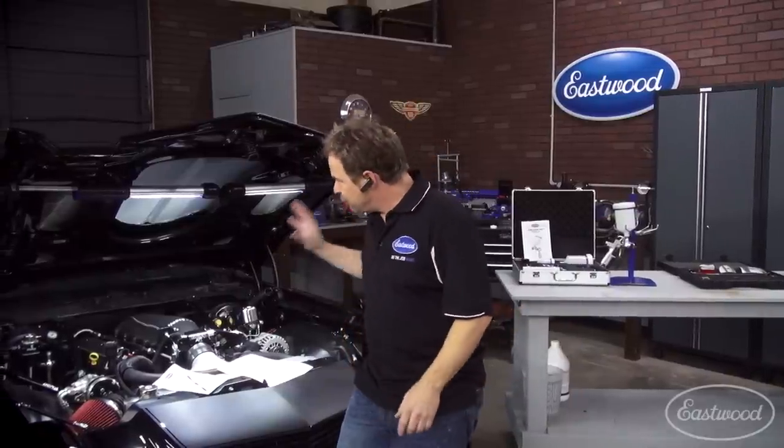But the fact that I had that aluminum spool gun sitting underneath my MIG welder allowed me to fix the intake manifold on Zed Sled, even though I'm not an aluminum TIG welder. And it was so simple that it really, really kind of saved my butt.